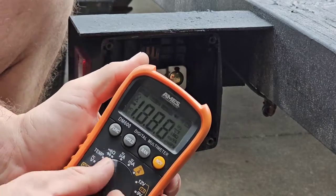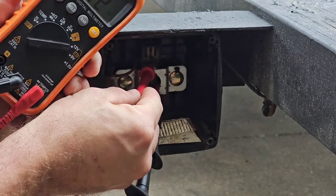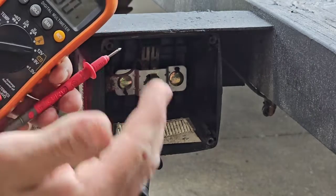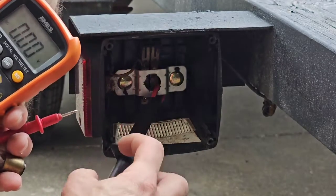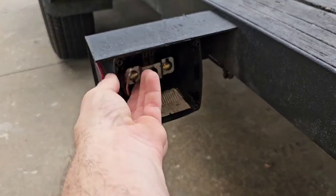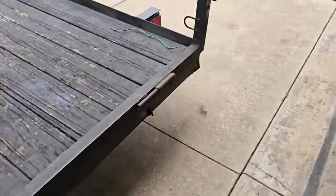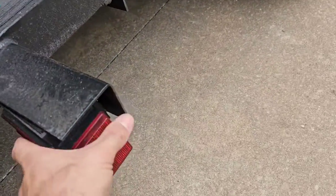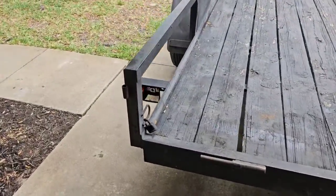With the multimeter, let's turn it over to 12 volts DC — vehicles run on direct current. We're getting 12.22 volts, so we're getting power to the strip. That tells me there's no doubt the strip is not making contact with the bulb. Since this light is already broken here, and it doesn't match the other light which is LED, I'm just going to go ahead and replace it with a new light. I came over here to look at this one and it's already kind of broken, so I'll just charge them for a new light kit. I know the wiring is good — everything's good.